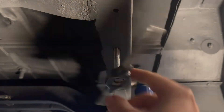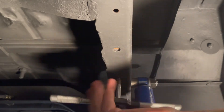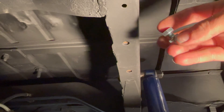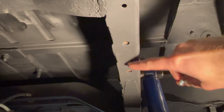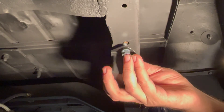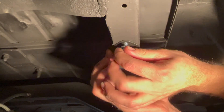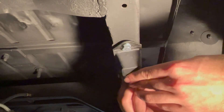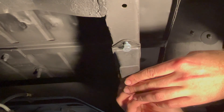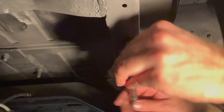With your 5/16 bolt, make sure you have a lock washer on so the bolt doesn't unthread on you. Thread the bumper onto the two holes — with the bumper in position, line up the holes with your bolts and thread on the bolts. Spending a little extra time re-threading these holes makes all the difference because the bolts actually thread on very nicely. With a half-inch drive, thread these bolts all the way in.